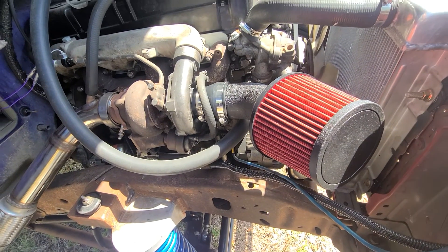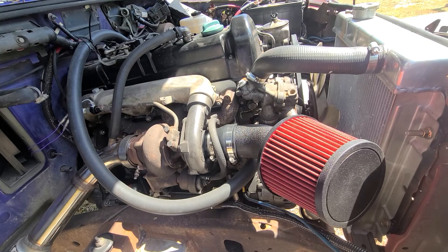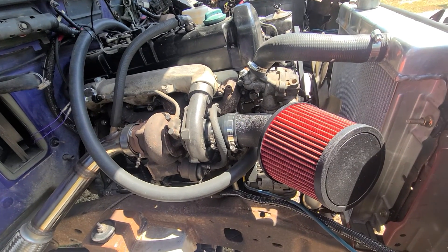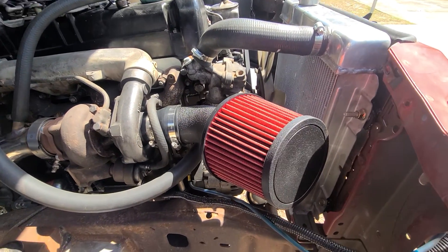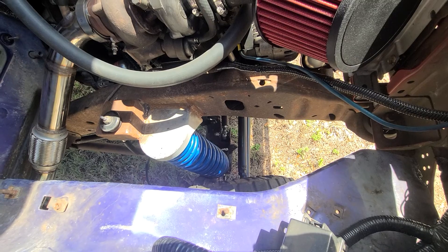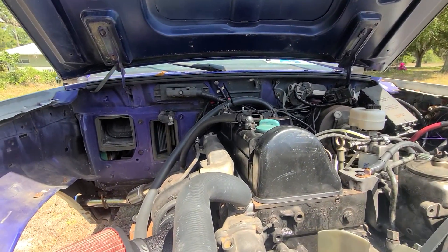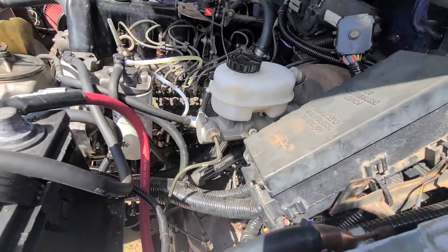I still need to notch the frame out for that. It has the sense wire, the RPM signal wire off the alternator, and a 12-volt signal wire with a 420-ohm half-watt resistor going to that to make the LS alternator work and not burn up. Off the engine bay harness it's just headlights, running light, turn signal, horn, and the starter wire. The AC housing is fully deleted.